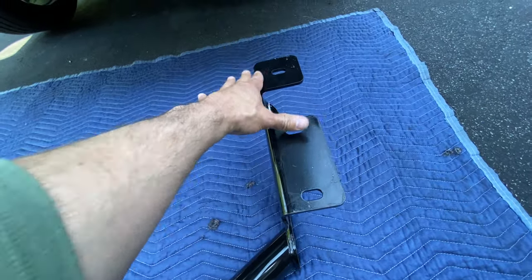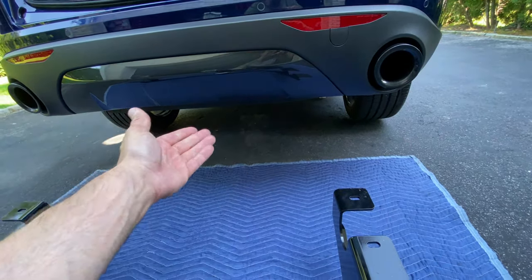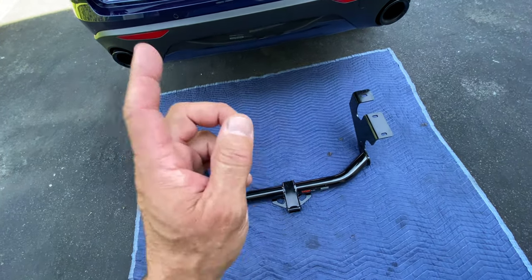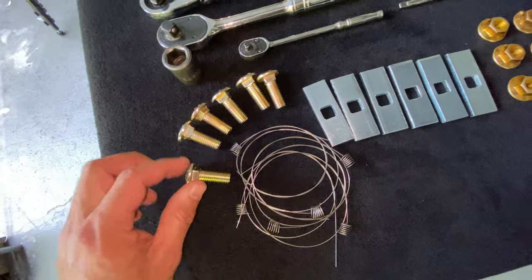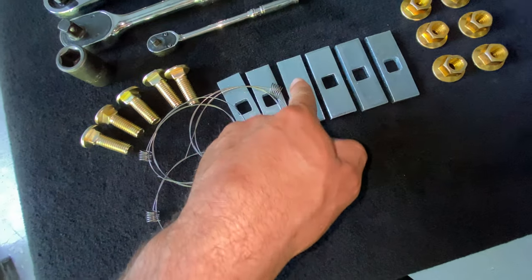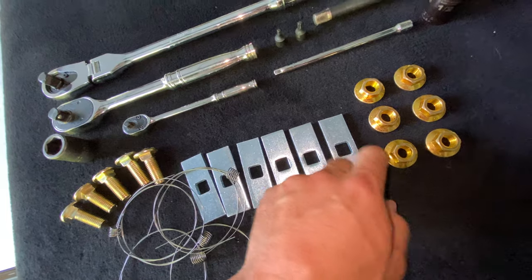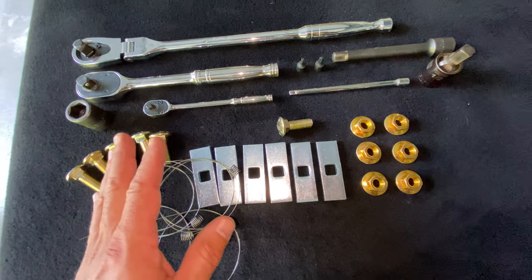There are only 3 mounting points on the left and the right. You're going to have to remove 2 panels underneath the rear fascia and do a little trimming — that's really easy. This should take about 20 to 30 minutes if everything goes as planned. These are the grade 8 hardware bolts. They call these fishing lines — you screw these onto the end with one of these support brackets and you have to fish it through the unibody of the car. As it comes down, you have your helper lightly thread the nuts on once you get into position and torque it into place.